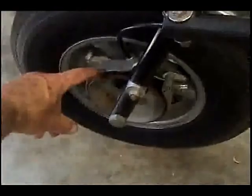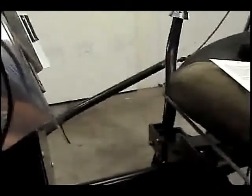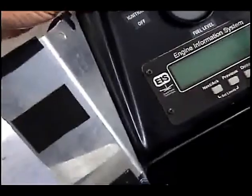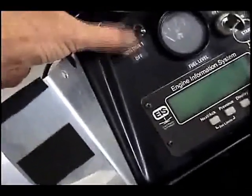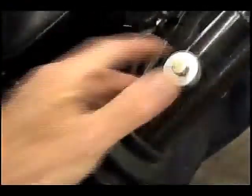Starting with the nose wheel — I'll make sure the tire rotates freely. It sounds like it might be grabbing a little on the shoe brake, but we'll check that later. The fender seems free. I'll check the turn bar to see if the front moves well. The turn bars seem free on both sides. On the checklist are the engine switches — just want to make sure they're free. That one may be a little loose, so we'll tighten it with pliers.